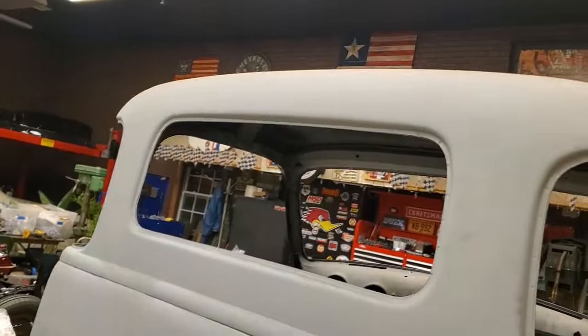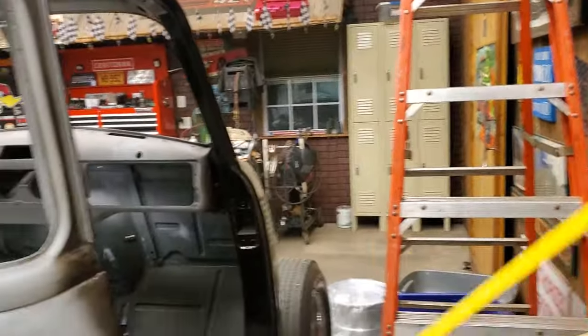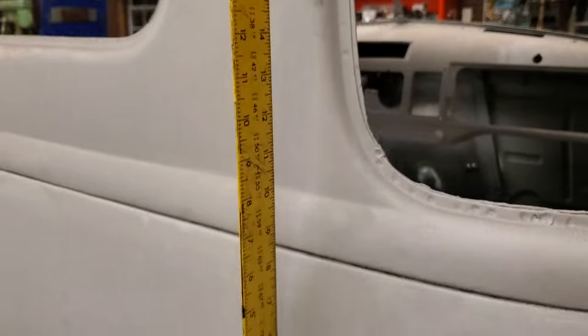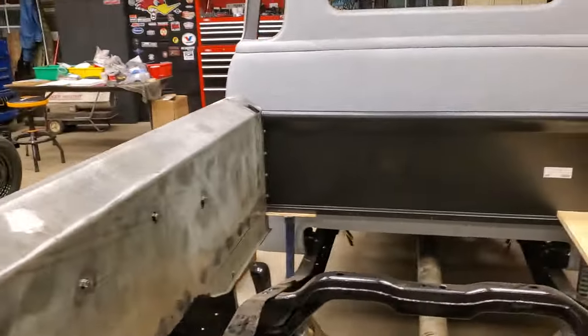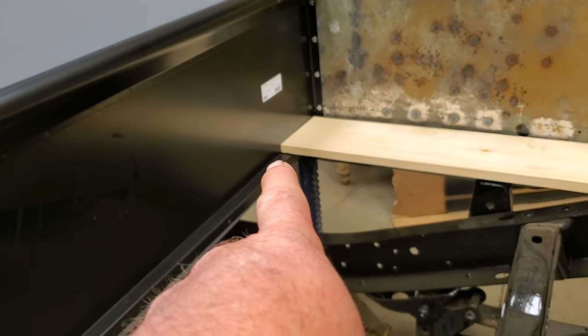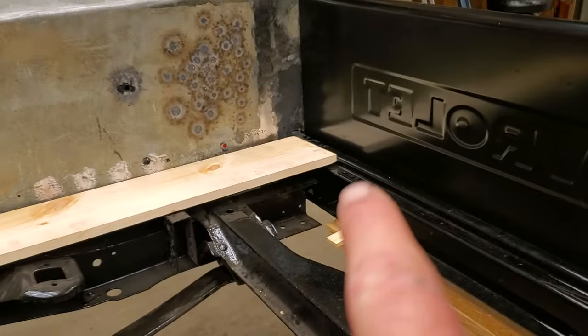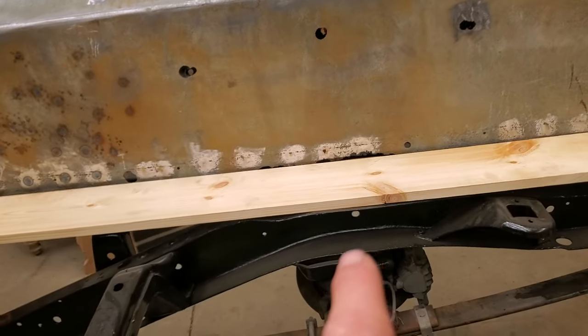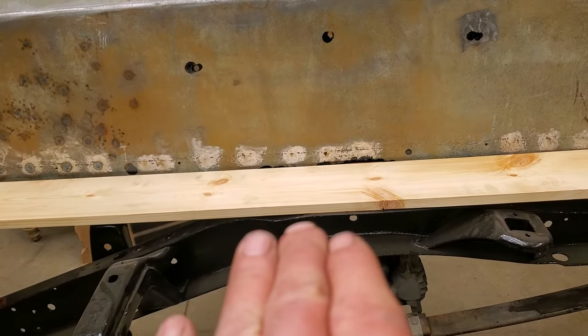On one side I'm about 8 and 3/8 inches, and on the other side I'm a little closer to 8 inches. I'm using jack stands which aren't the greatest because they've got center pieces that move around. Anyway, I had it set up at 8 inches off the belt line, and the reason I did that is because on the 88 S10, notice this board — it's sitting on the lip on the front tailgate panel, sitting on the lip on the rear tailgate panel, and it's sitting right on top of that frame perfectly, which is great because it's going to help support the bed.